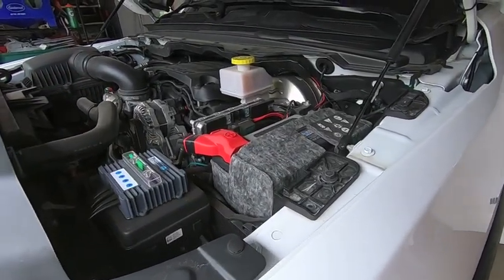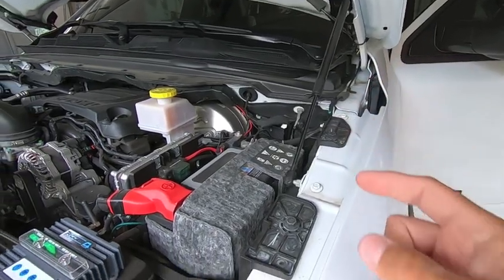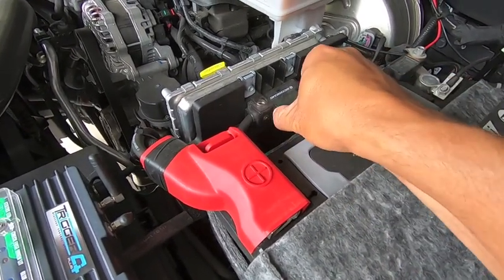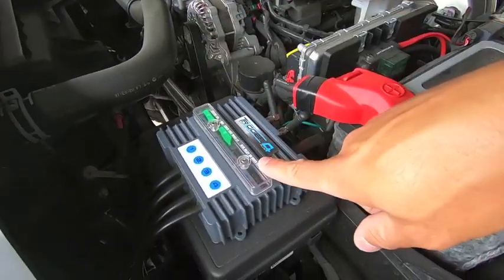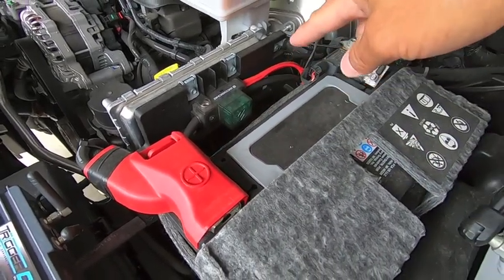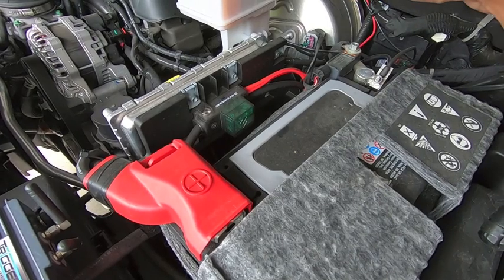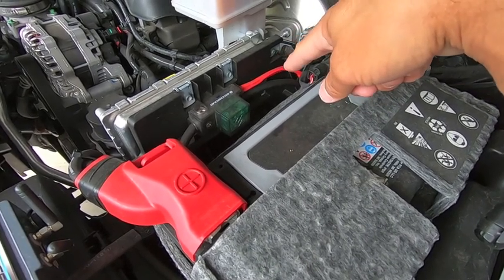For main power, I'm under the hood. I installed a dual-output battery terminal with two maxi fuses — when I did the stereo upgrade I knew I'd also be adding aftermarket lighting, so I wanted two fusible outputs. I have power running into the front of the terminal and four-gauge wire running out the back. All my stereo wiring is from a company called New Concepts — I've used their wiring in my last truck and my dad's boat. It's super-quality wire with a slick coating that makes pulling through the truck much easier.